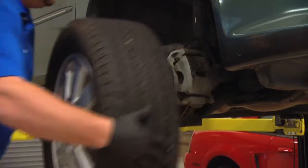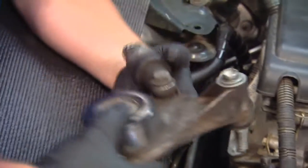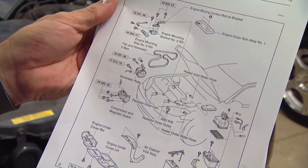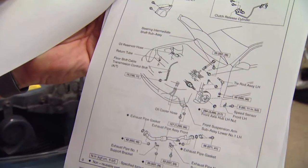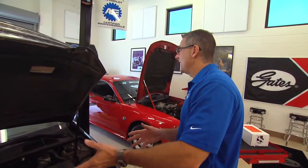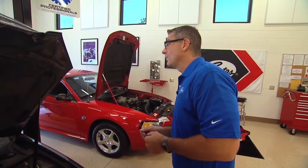The first thing you have to do is remove the front wheel and a few mounts to access the tensioner so you can remove it. We're simply going to take the old tensioner off and replace it with the new one in the same order. Remember to always check the service manual on the car you're working on. Looks like you got it fixed — all we need to do now is crank it up, make sure everything's running fine, take it on a test drive, and when you get back recheck it one more time.